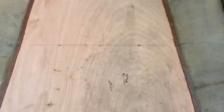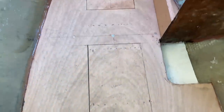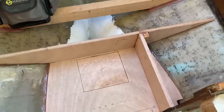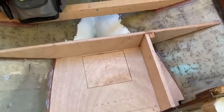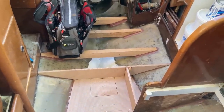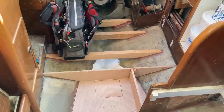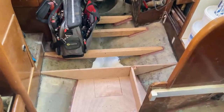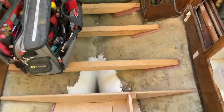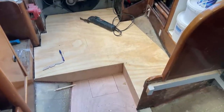I've just put a little smear of thickened epoxy just around the edge where the wood is going to butt up against the hull, so that will mostly squeeze out because it's a pretty close fit all the way around. And there we go — the floor is down and it is not coming back up again. I've used three screws through each of the floor bearers to hold it in place and also put an initial bond in on the step front in there as well, so that's glued and screwed in place. I'm probably going to stop for lunch soon but after lunch it's going to be templating time — I've got to make a template for the step top and work out where the hatch is going to be so it can access the new seacock going in between the floor bearers.